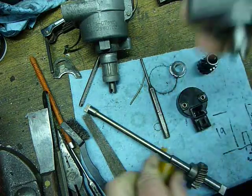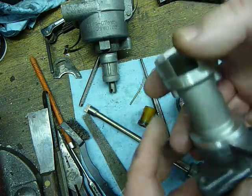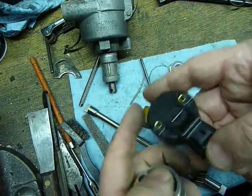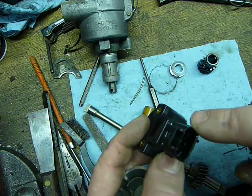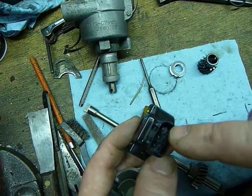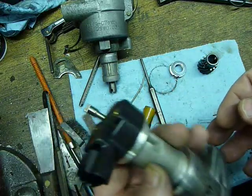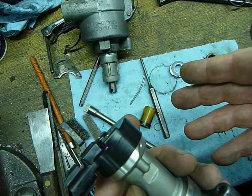Shaft sticks 19 millimeters down from this surface. It's a 2001 Jeep 4-liter straight-six cam angle sensor. Rock Auto has them for about $35. The next piece is going to be verifying exactly what's what with the wiring. I've got some notes and I'm digging around in some of the Jeep stuff, but if I remember correctly, the center is ground, I think this was V-Ref, and this is Signal — but I could be wrong. Nice, tidy little package. It'll drop on like that, nice and clean, and then I can run full sequential ignition and injection with the turbo project.